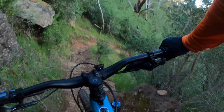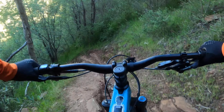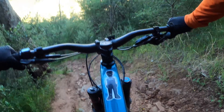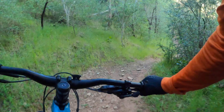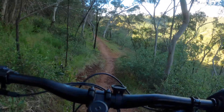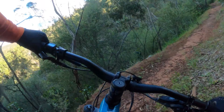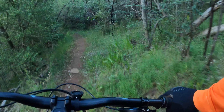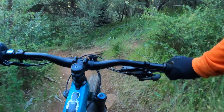The Lyric is definitely outshining the ZEB quite easily at the moment. The Fox 38 outshines the ZEB for sure - I think I'm into that spring when it's serviced and not full of grease on the negative side. One token if you like them higher, two tokens if you like it a little deeper in the sag - one token in the Fox 38 is quite a good spring. You've got to know how to set your high and low speed, definitely your high speed rebound and high speed compression. I love this fork - I just wish I had high speed compression, because I need one click more just to make the overall stroke feel stronger, then I can back off the air just a touch. It's just smooth, quiet, handles everything - can put it on whatever line I want. Easy.